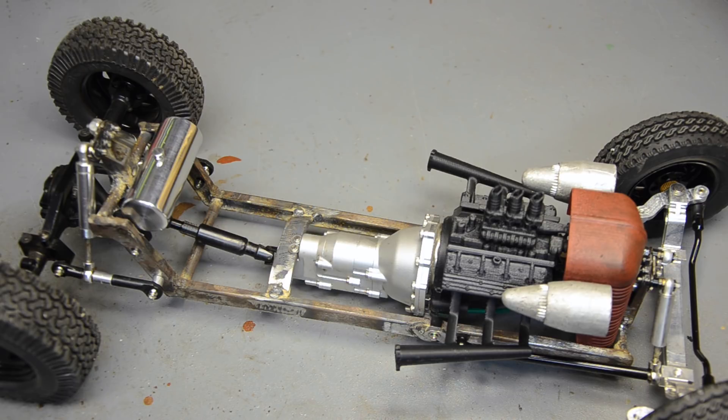I did have to modify the front crossmember — the bottom of the transmission had one little round part that sticks down and I had to grind a bit of it back. I'll clean that up too; it's just a mess in the workshop today. My new toolbox came unexpectedly last night so I'm trying to shift everything from one toolbox to another, and I can barely walk through here.